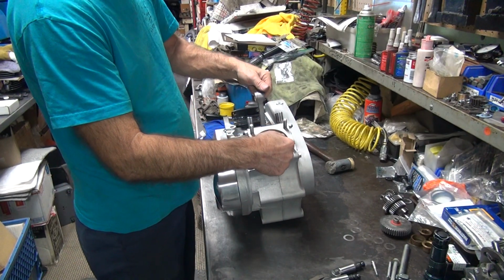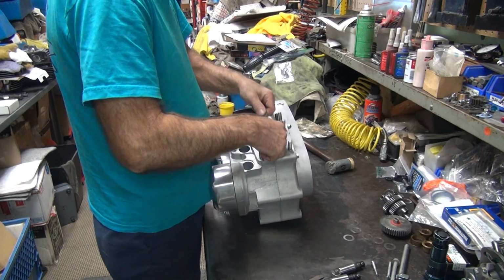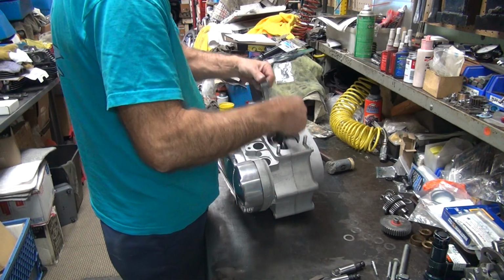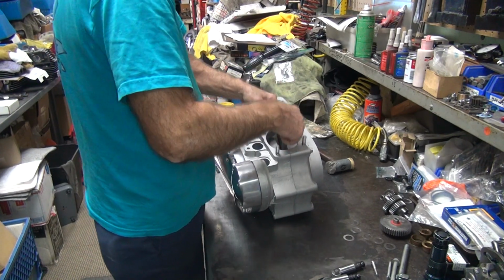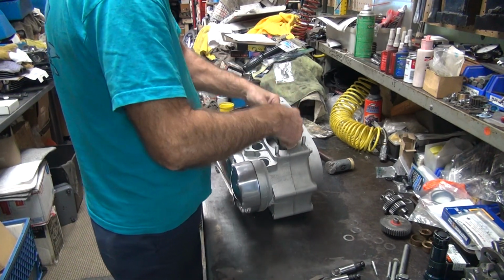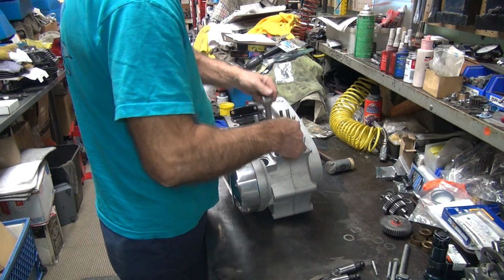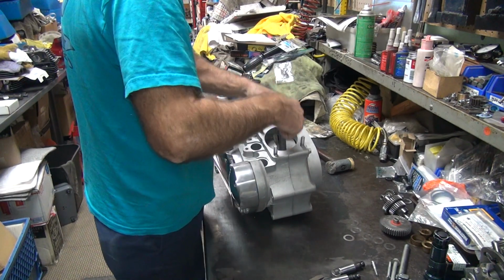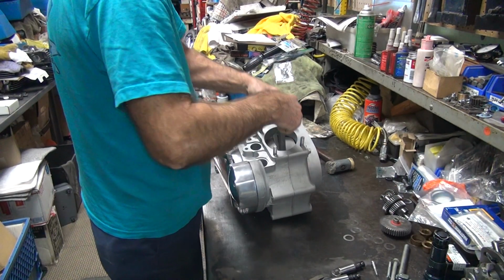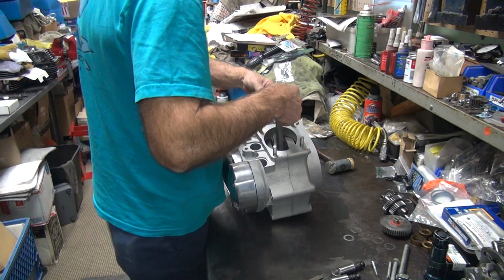A little freer. Have you ever seen anybody chop a Sportster transmission off the case and then hook it up to a big twin? Chop them, yes, hook them back up to something, not very often. They kind of get lost. Couldn't you just put it into a specially modified frame? Still gotta figure out how you gotta hold it. When you cut the back of the case off, there's nothing to hold to. Because you cut that rear motor mount off. You can't make a new motor mount like these ones here. Have to weld the back of the case. You'd essentially have to copy how a big twin is mounted.